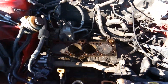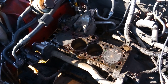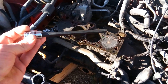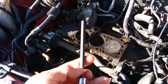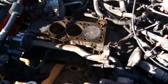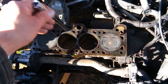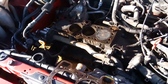I have the cylinder head off. There's not much to getting the cylinder head off — if you watch the previous videos, I show you everything you need to do and take off to get to the point where you can remove it. Once you get there, what you're going to need is an extra long eight millimeter hex head socket — metric, eight millimeters, extra long. Then it's just a simple procedure of following a zigzag pattern, starting in the inside and working your way out to loosen and get the bolts out, pull your head off, and you're left with your engine block.